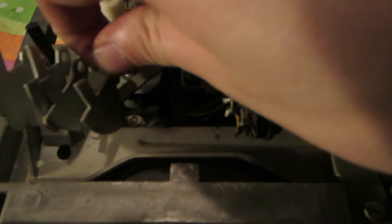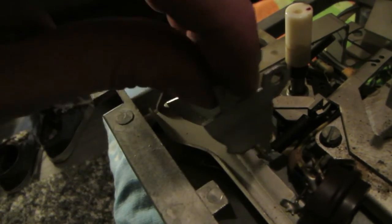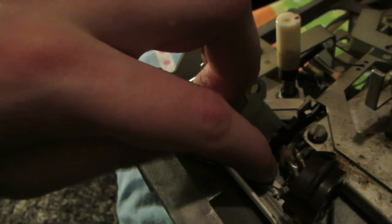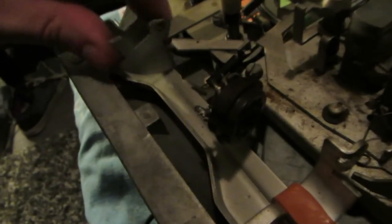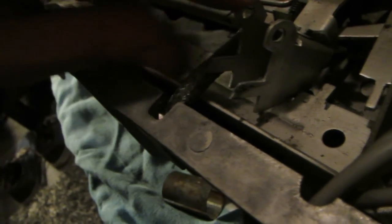Now that all the buttons and covers are off, we can have a better look at this button system. It's very interesting how they did this - they're all like parts that rotate on a central axis. When you press a button, it will actually hook behind this big bar here. So this is rewind - if I press this, it pushes the bar down and hooks behind it. When I press stop again, the stop button will actually push this bar down again, making this button pop up again. This is a very interesting little construction.